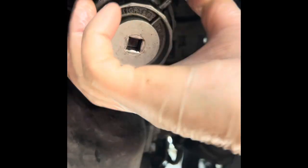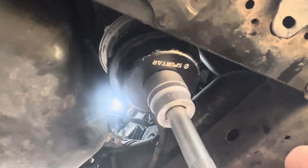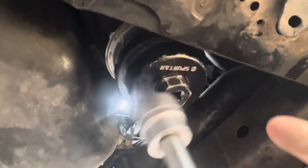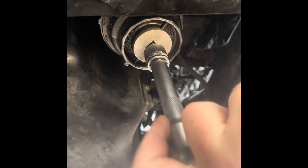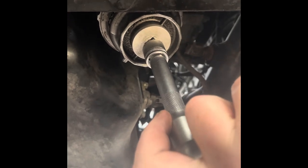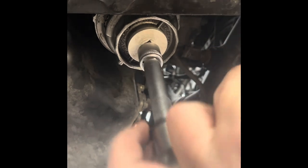Tighten it up and get it up to 40 plus 8 — 48 newton meters. Tighten it up. There we go — 48 newton meters, exactly where it needs to be, no more, no less. Now we have to tighten this drain plug — 12.5 newton meters. There we go — 12.5, beautiful. That's the torque specifications done for the filter housing and the drain plug.